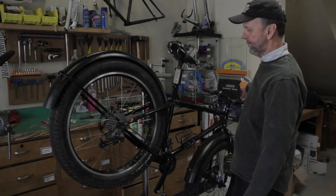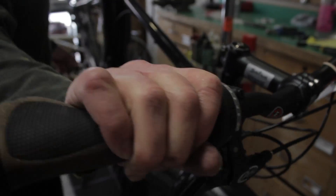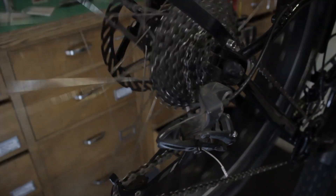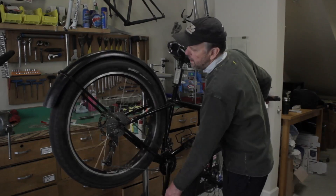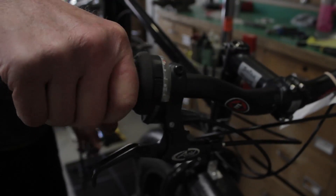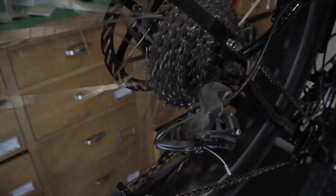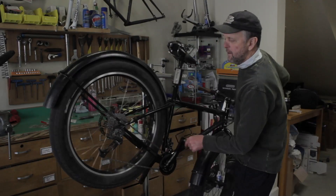Now we have our cable attached to our rear derailleur. So we're pedaling and we shift, tensioning the cable on the rear derailleur. It's forcing the derailleur, which in turn guides the chain to the next cog where it engages and climbs up onto the next bigger cog. Then when we release tension on the cable by shifting the other direction, the derailleur returns with its own spring tension and pulls the chain away from the upper cog, letting it drop down and engage with the teeth on the next lower cog.